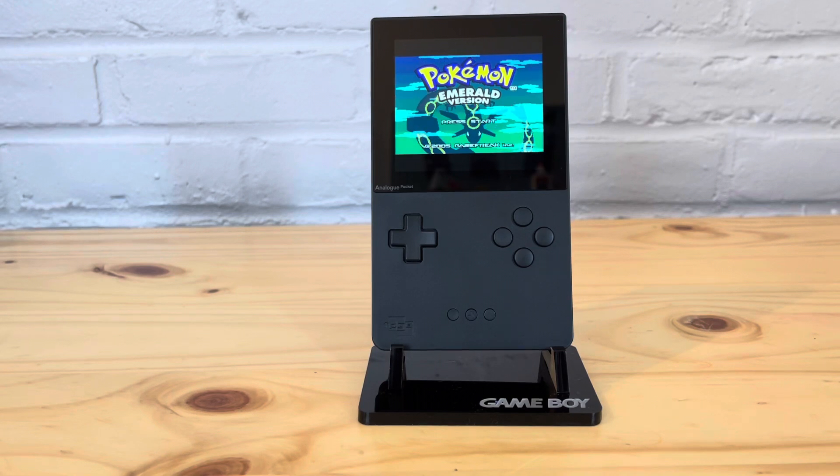It barely met its minimum. I have a feeling if you pump out the volume and do full brightness, you might be looking at maybe five hours or less. I'm very interested to know what their parameters were. I used an Anker 65-watt USB-C charger and it charged much faster — under two and a half hours for a full charge. If you have a 65-watt or higher power brick, you'll get a faster charge — same as any device with fast charging.